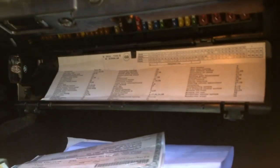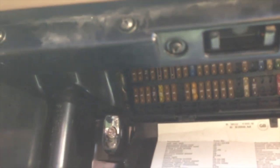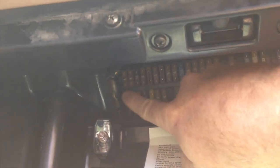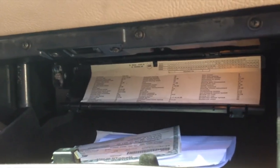I'll show you what we found. Sitting on the trailer fender, I opened up the glove box and pulled every single fuse out one at a time. It has a card that shows you what each one is. We ended up having a blown fuse — a 7.5 amp — that was number five at the top. You can see we replaced it right there, that's the new one. Once we replaced that blown fuse, it started right up.